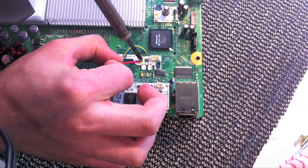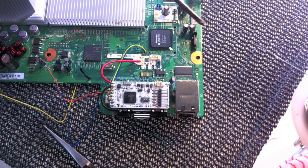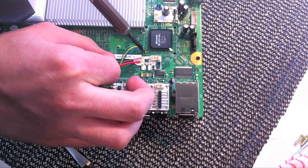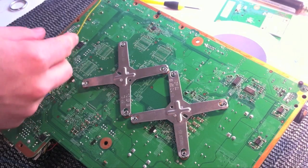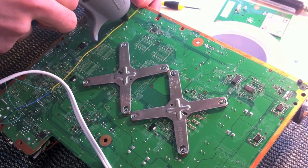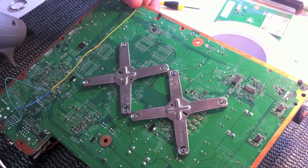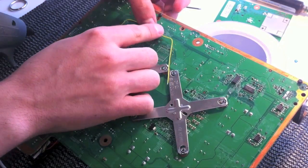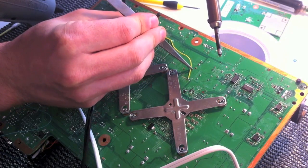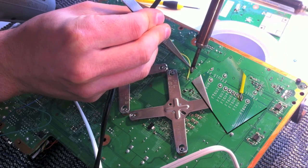Make sure the red wire is soldered securely to the 3v3 pad on the TX-QSB. Next, take your orange wire and solder it securely to the B-pad located on the TX-QSB. Now, let's carefully flip the Xbox's motherboard upside down. Run the yellow wire up and over. On this installment, I'll tack the right angle point with a little glue from a hot glue gun — not a ton of glue is needed to mount these wires in place. Once I have the wire situated, I solder the yellow wire to the C-point in the TX-Wiring diagram, which will be the FT6U7 point on the motherboard.